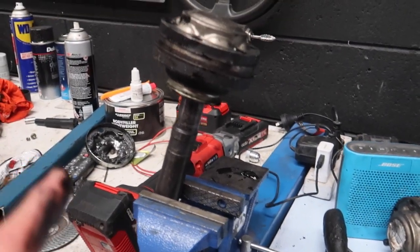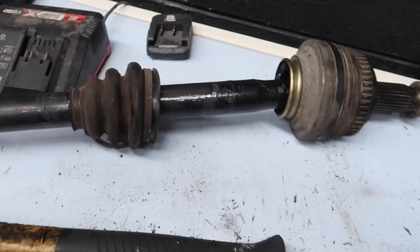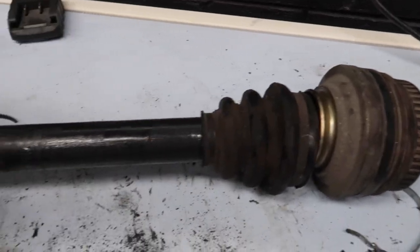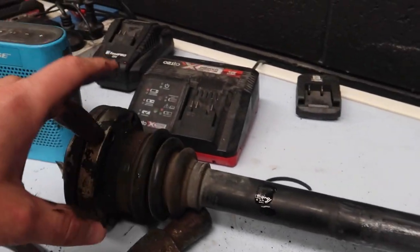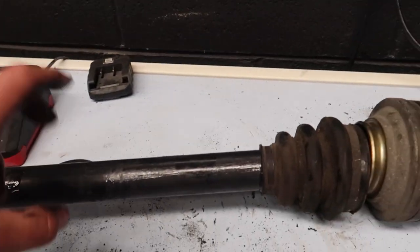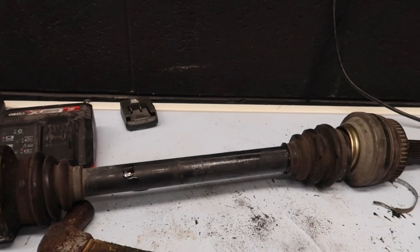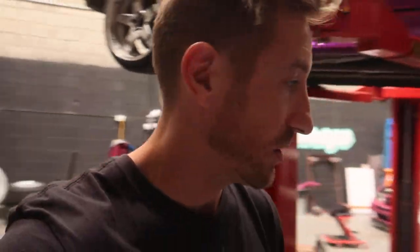Now, another thing, sorry if I'm talking a lot, but there's a lot of information to take in. So this axle here, and this is the cool thing, right? A friend of mine in Europe, Tyrone, reached out and said the E46 passenger side axles fit into E36s. Medium case, of course, because we're running medium case. So E46 have different length axles, driver side and passenger side, which is super weird, but the diff's offset. So I wanted to test that theory.